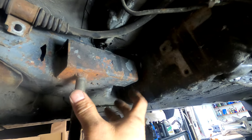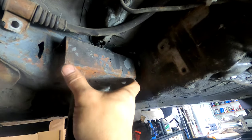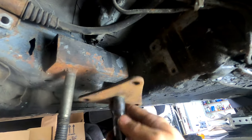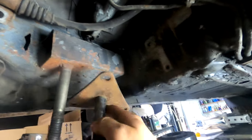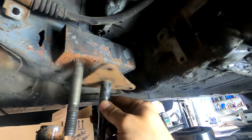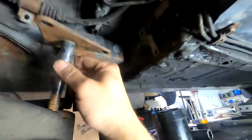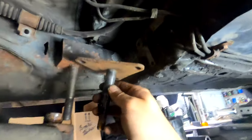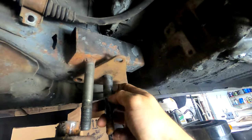I'll have a second piece with nuts welded on the inside so I can bolt the mount to that secondary piece, then weld that secondary piece to the frame above. That way we can unscrew and remove it, or when lifting the subframe into place, it can float around loosely inside and then get bolted in once positioned correctly.